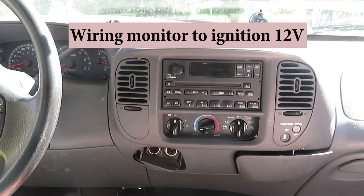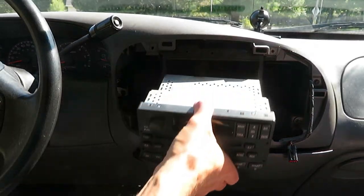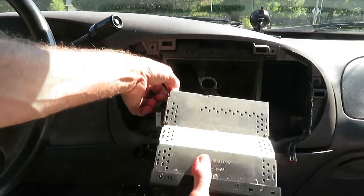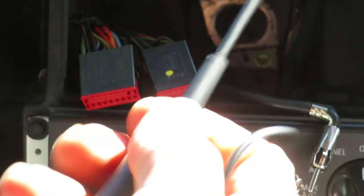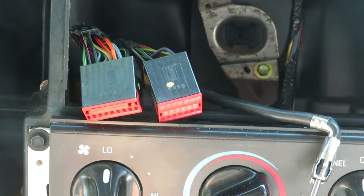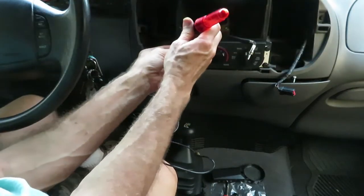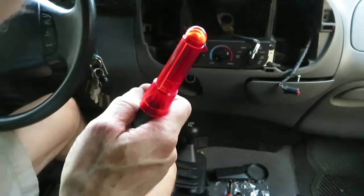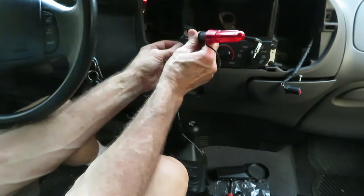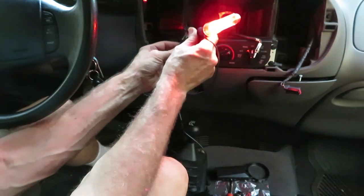The easiest way to get at running 12 volts or always 12 volts is to pull the radio — usually just a cover, four screws, and there's the wiring harness. Those two wires are going to be found on this harness. If you have a schematic, that's ideal; if not, probe the wires with a sharp tipped wire probe. Put the banana clip on a ground — a really reliable ground is right on the DC jack, clipping it on the outside ring. With ignition off, probe for always 12 volts. When it lights up, that's our wire — sometimes also called battery plus. Then with ignition on, look for the ignition 12 volts.